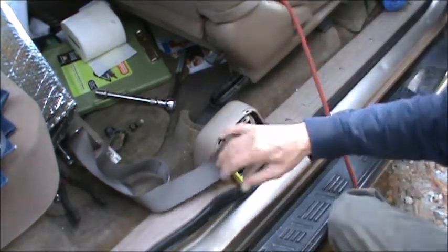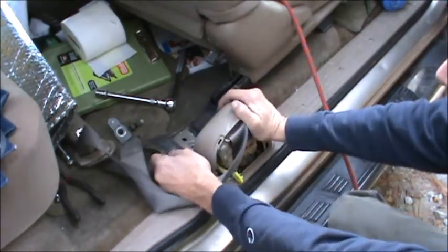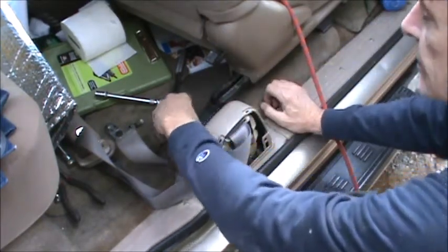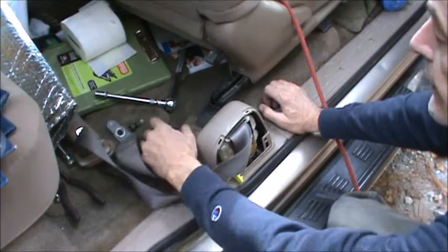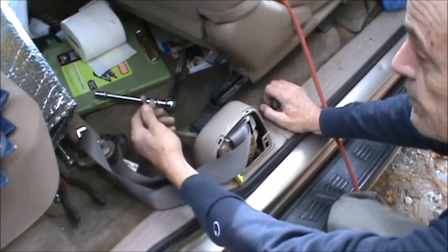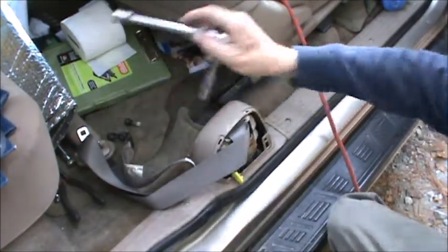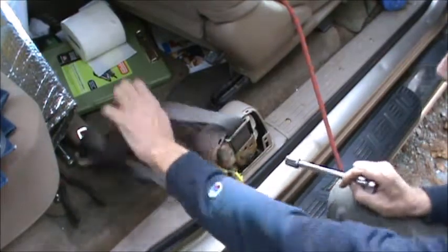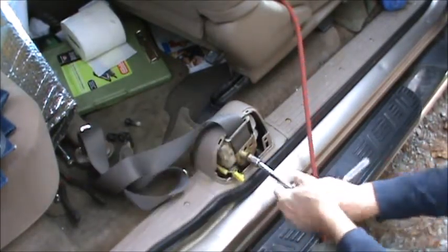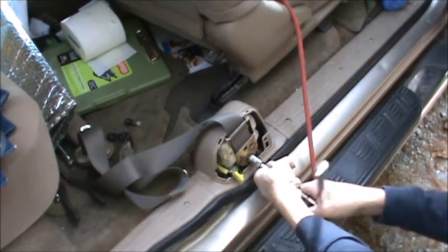This was a little interesting when I started looking at the carpet more — the factory's already got a flap that just slips under the plastic piece here, so you flip it back and there's access to the bolt. As for the front, I've already unplugged the connection and broke it free before I shifted the camera.